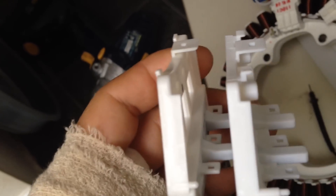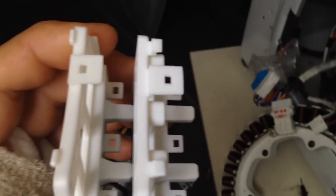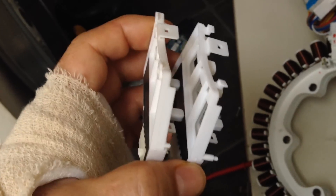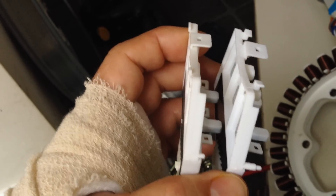You can see the reason for that - the new part is on the right and it's got those additional little plastic tags that make it stand off. Even the lengths of the sensors are slightly different, and the hole position of the back tab is also slightly different. It's about 5mm higher than the old part, hence why the new part doesn't fit correctly on the motor - the rotor assembly doesn't sit flush against the drum. I would actually recommend going for the 1A part. So thank you to all those people on the internet for recommending the wrong part.